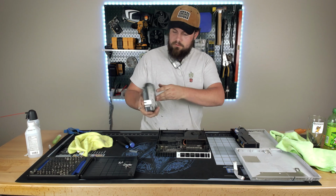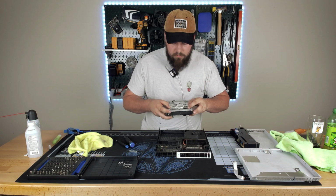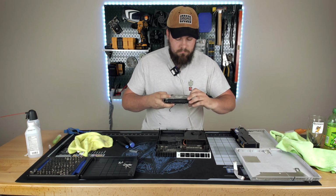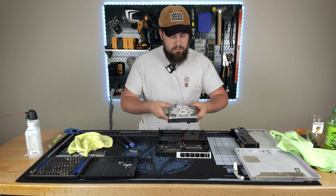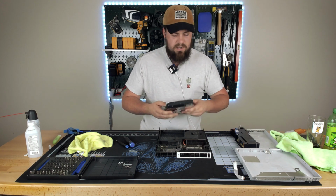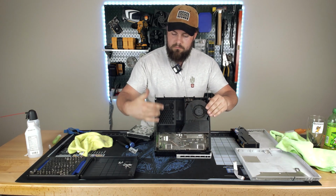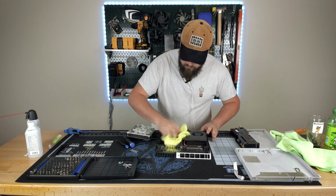And that's that. That's the CD drive for you. Oftentimes these rollers right here will kind of be worn out or go bad if you play with discs a lot. And then there's also like a connector piece between these gray rollers here that sometimes disconnect, but it looks like everything is in there as there's no rattling either. But if there were, you can easily just remove these plates here and then you could gain access to all that. But besides that, there's not too much dirt in this, as this compartment itself is a closed off section from everything. So there's just a little micro dust in there, but nothing too major.